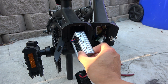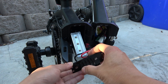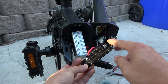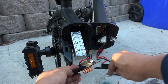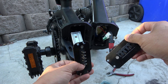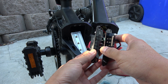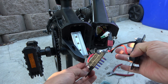On the left side we have the controller and a connector with five pins, but only two pins are being used — one on the top and one on the bottom. These are the main power cables going to the controller. The same is true on the battery side — only two pins are used. So when you unfold the bike and put it back together, you connect those two pins and the battery connects to the controller. Quite simple.